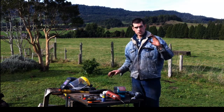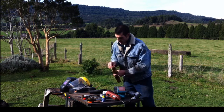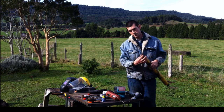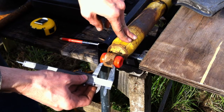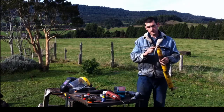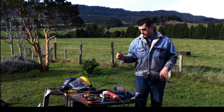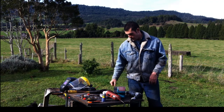I have the shock on the truck still, but I did measure the shock mount housing. This shock, while it's in really bad shape and not one I'm using on any of the vehicles, it does have the same width mounting point here. So I took my caliper and measured the distance of this spacer for the mounting point, and I made sure this one was the same as the one on the truck — and they are the same. I'm going to use this one as a mock-up piece for the pieces I need to make here and then in the end welding these tabs together.